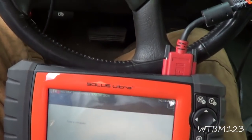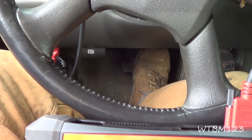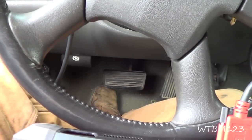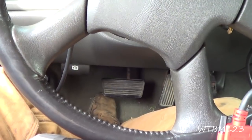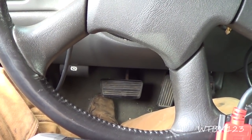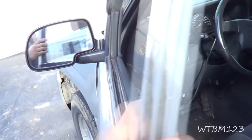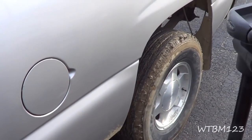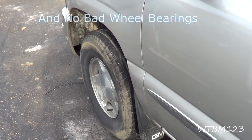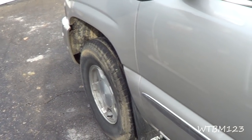The test is complete — let off the brake pedal. That should have given you a better feel if you had any air in there. Sometimes you'll have to do that a couple of times to get all the air out. Keep in mind that if there was air in there, it went somewhere, so I usually bleed the brakes pretty well after this — I put the vacuum bleeder on there and suck brake fluid through. This automated test should only be done after you've made sure the rear brake adjustment is correct, the front calipers are working properly, the slides are good, there are no brake leaks, and you've already tried to bleed the system.